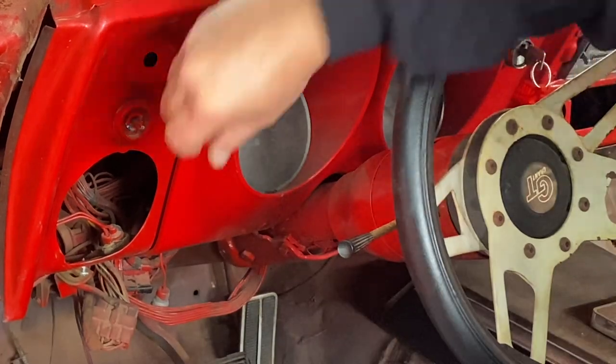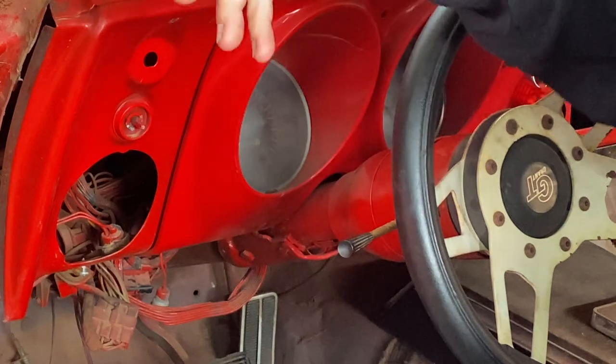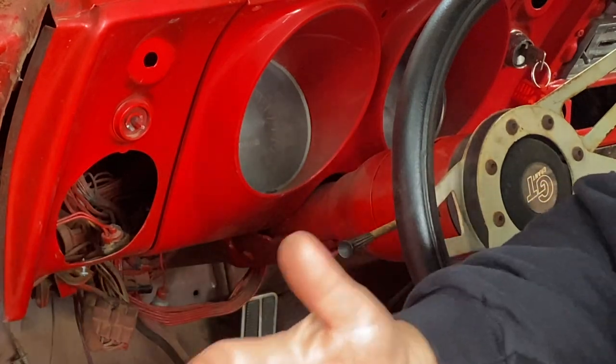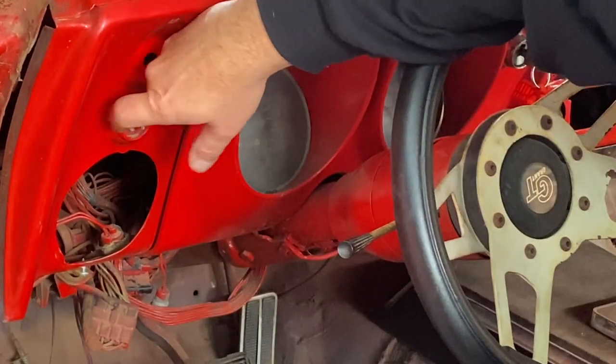Well, as you know, we have no lights — no brake lights, no taillights. We got blinkers, but no taillights. Since we have blinkers, obviously that tells me that the lights are working and the wiring is correct. The possible problem is with the switch.